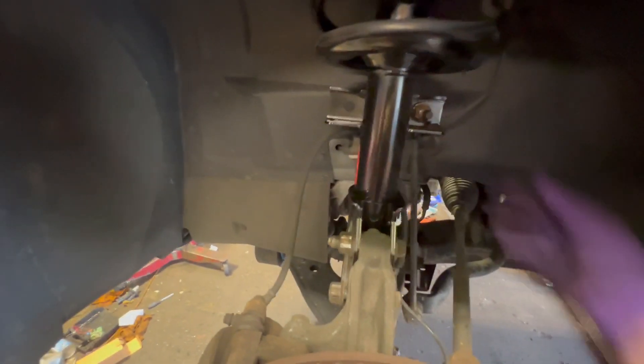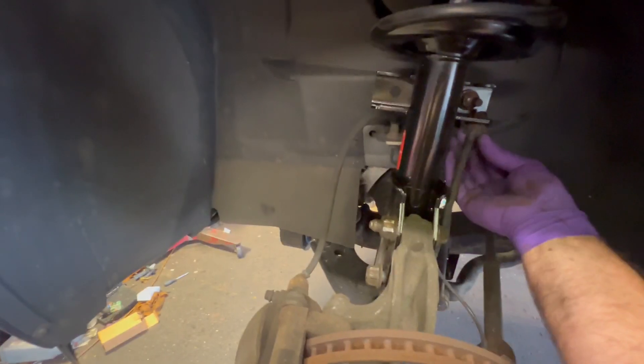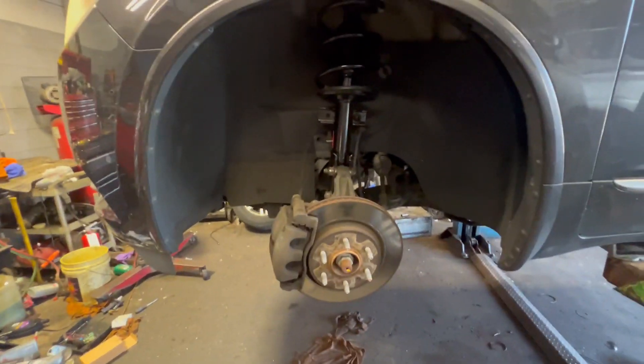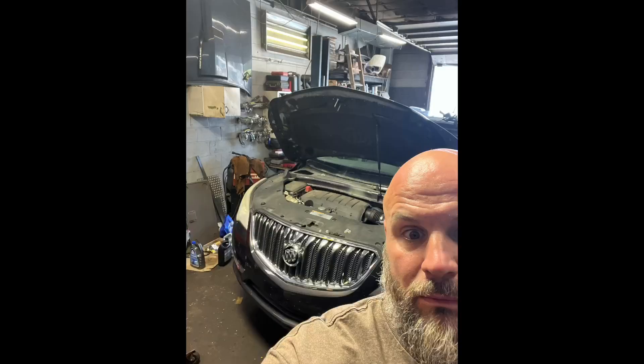I'm not a mechanic — I'm a parts replacement professional. We're zapping it back together. Like I said, you don't even got to hold the back side if you get it on so far. Preferably a deep socket there, but I make a shallow socket work by taking it off the gun a little, sticking it on the bolt. Make sure the wire's routed correctly. Two bolts in nice and tight, three bolts up top nice and tight. Everything rerouted — wires, hoses — the way they were in the beginning of the job.